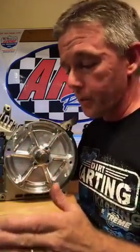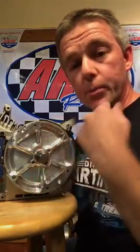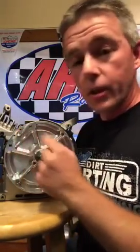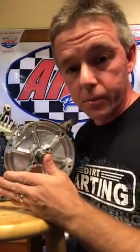Very confusing for a lot of people because they get these flywheels, they put them on, they read our directions, or they don't read our directions. Sometimes they don't have directions in it, David and Taylor. But they'll take it and spin it with a drill, just like they do their 6619, and look at where it's firing. It's not going to fire in the right spot.